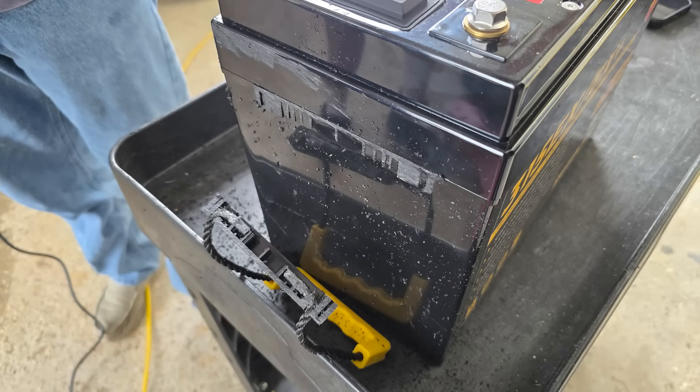The step well tray inside the Winnebago 24 View is a little tight. It's actually not quite Group 31 size — it's a little undersized — and because of that our handles can interfere with it. What we're going to do is cut one of the handles on each battery. On the side where the positive and negative terminals are, we're going to take a reciprocating saw and very gently remove it. If you follow the process it should come off very easily. It will not affect your warranty as long as you don't cut into the case, but it does require a little bit of modification.